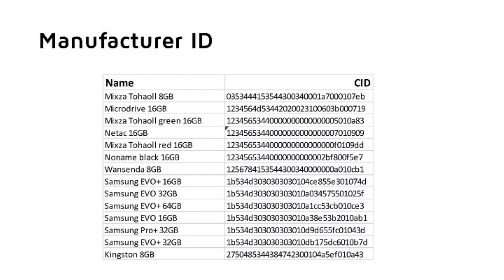There is an additional problem with clone cards. Who is the manufacturer? You should find the manufacturer in a field called CID. The first two places of this long number should point you to the manufacturer. If you look at the Samsung cards, they all start with 1B. The no-names have very strange numbers — 123456 looks like a really bad password. So even if you order a Microdrive SD card today because I measured decent values, it is not clear if you get a card with the same properties, as the seller may have changed their manufacturer in the meantime. You will still read 123456, but the speed values might be really slow.